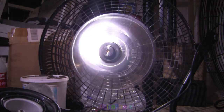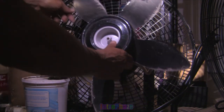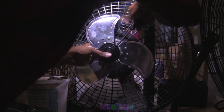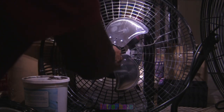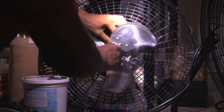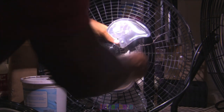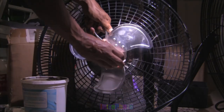Just having three blades going at the same speed versus five blades on the plastic fan — the three blades have more airflow between them. It's like if you installed a plate with no holes in the middle, you're not going to get any airflow because there's no space between each fan blade. So if you decrease the amount of blades and curve them, you actually get more airflow at the same speed than having five blades.